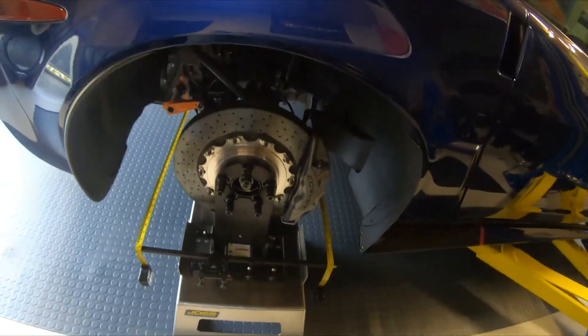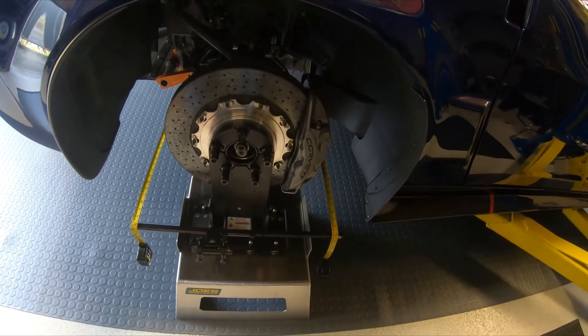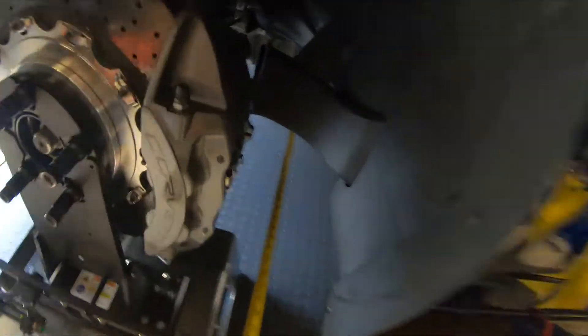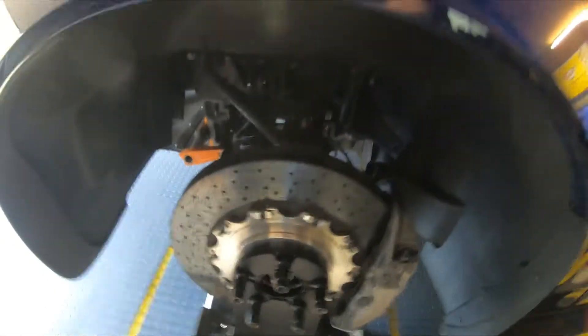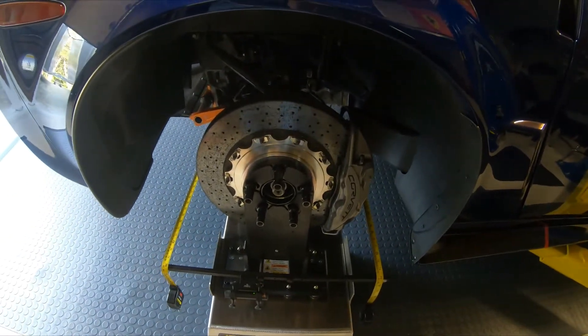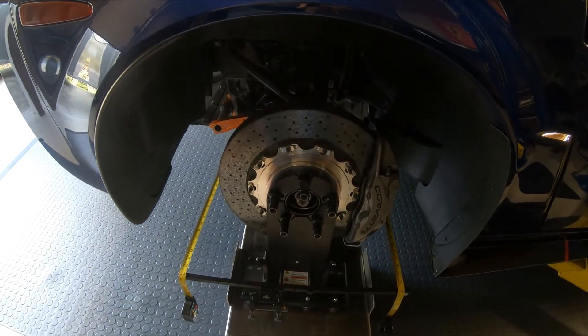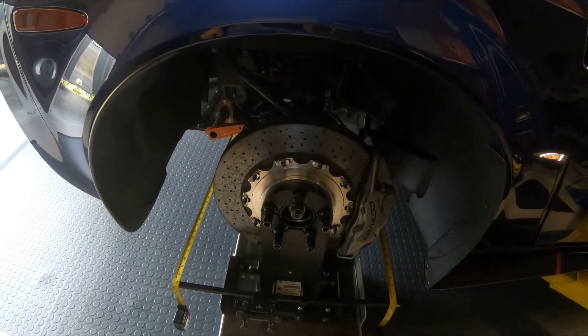This particular car is going to be running Michelin slicks. It actually handles better with a little more toe in. Only the front control arm is adjustable as far as the shims — the rear is fixed. So you're basically setting the camber with the front and then setting the toe. The C7s have both lower control arms with the ability to shim them or use eccentric adjustments.